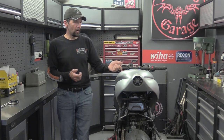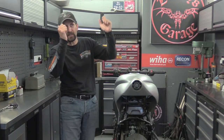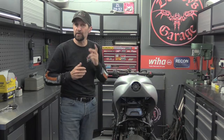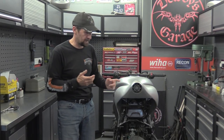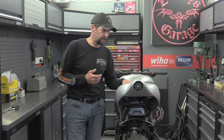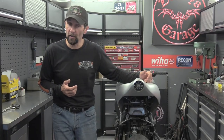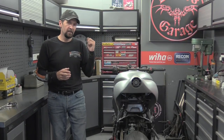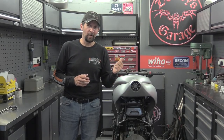That means bodywork off completely. Check the tap underneath - I'll put a little bit of fuel in there and just see if it leaks underneath. If it leaks out the main seal, turn it on and off, because it's not a vacuum tap, it's a gravity tap because it goes into a pump. That also means I've got to connect up all the electrics, I've got the battery to put in, I've got an earth to drill and tap and connect. Then plug all the electrics in, get everything plumbed together, hit the button and hope. Let's give it a go.